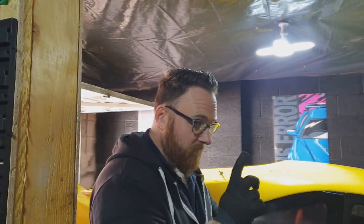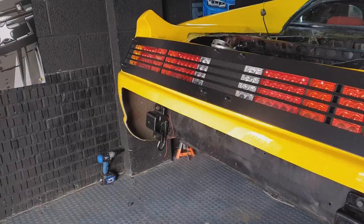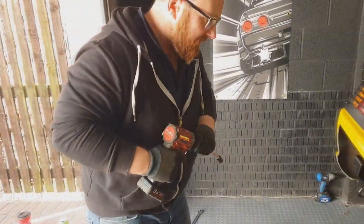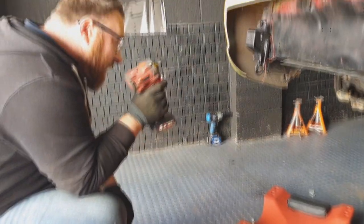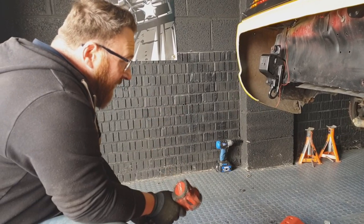Awesome. So we have repositioned the MR2. We're now as far forward as we can be, so we've got more room for activities out back. Now all that remains is to start making things come off. We're going to start with disconnecting the hubs from the subframe, disconnect the rear torque mount from the subframe, and then we'll drop the subframe off. That'll give us a lot more room.